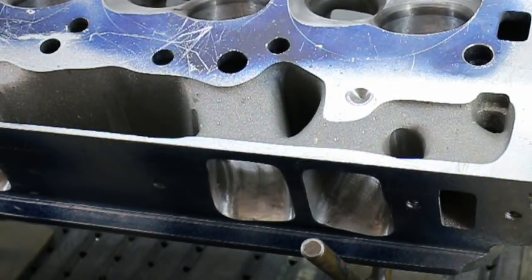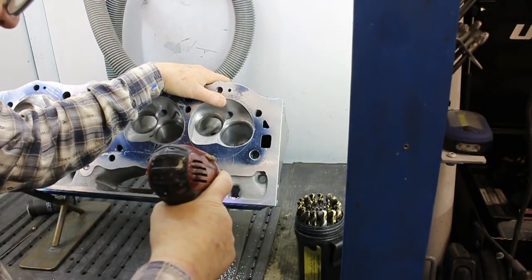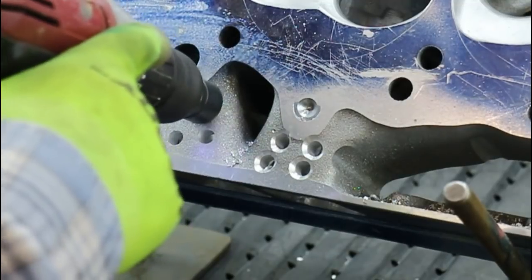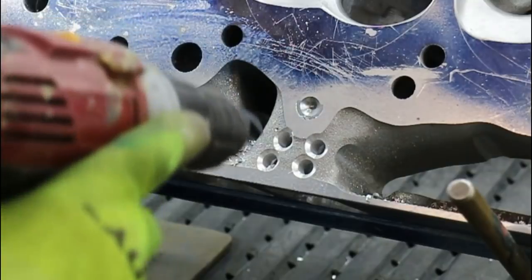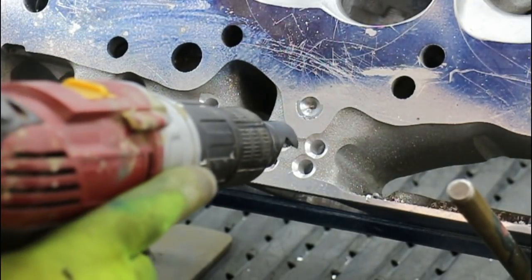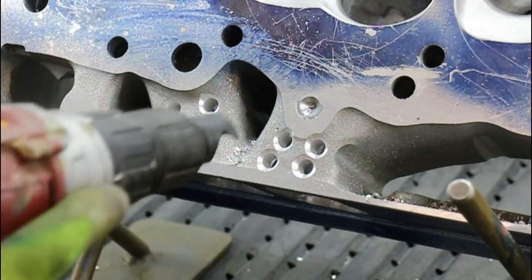We're going to make those holes fairly large, almost coupling up to each other, and they will act as a key. The bigger the holes are, to an extent, the better. Last operation on the underside is to give them a good big countersink like this so that there's plenty of material keying the filler in.